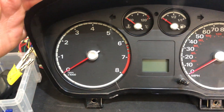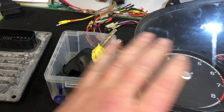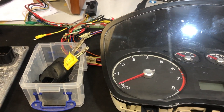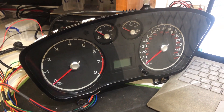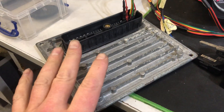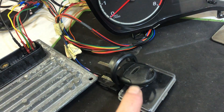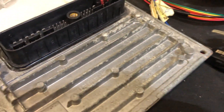So it's going to be in miles when he's driving down the road — all correct. Now what we're going to do is adapt the keys to the cluster and the cluster to the ECU, rigged up on the bench. We're all set up — the cluster is connected at the back, connected via CAN bus to the engine control module, and the key reader is all connected up. We currently have a key in there, but it's not programmed to this cluster or this system.